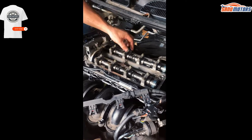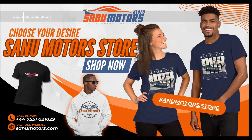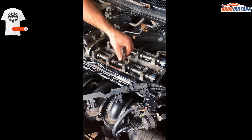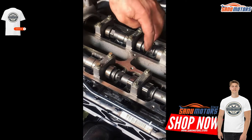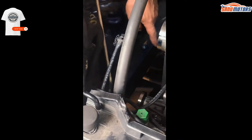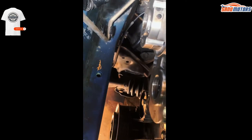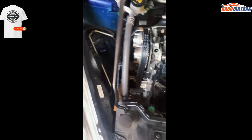What you do have is them things sticking out like that — it's very similar to ecoboost engines. You put a square-shaped bracket to make them square and facing up. You've also got the locking pin on the back of the engine. There's a little plug that you remove, like on the normal Focus, and you put the timing pin in instead.